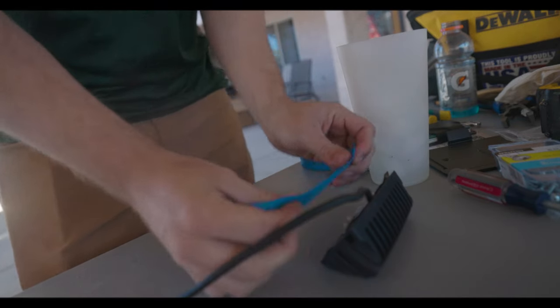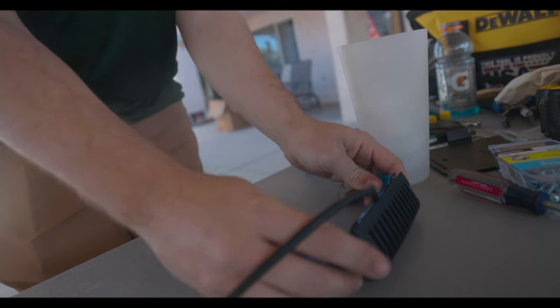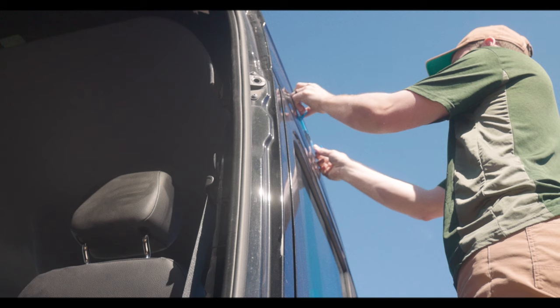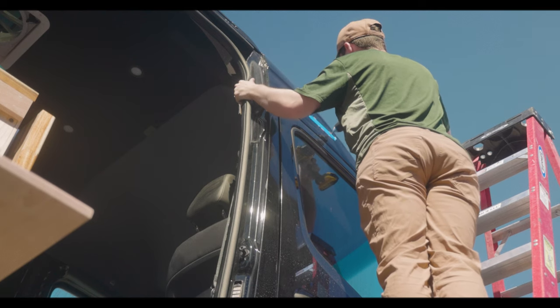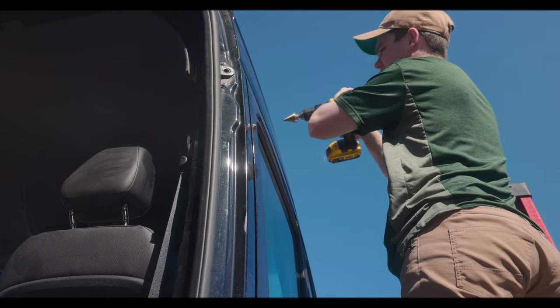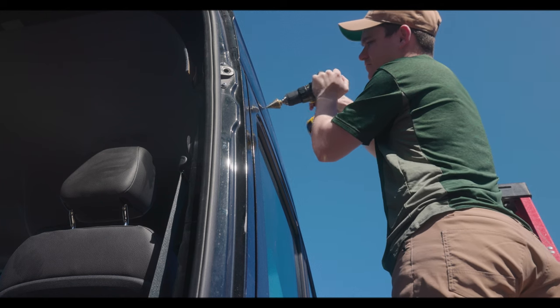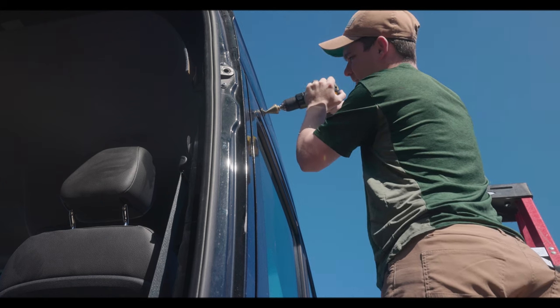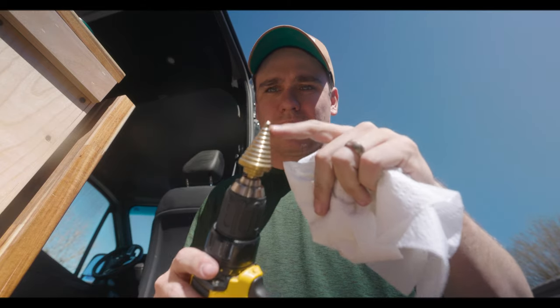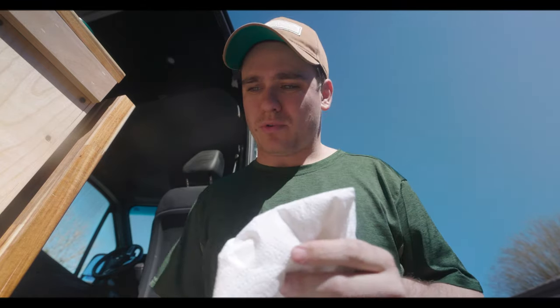We used a strip of painter's tape on the back of the light and marked where the mounting holes are on that tape, so I could use it as a template on the side of the van. With the tape in a place I liked, I drilled pilot holes using a really small drill bit, then came back with a step bit and widened those holes to the appropriate size. There are three holes — two for mounting and one for the electrical wires to go through. I used the step bit to make sure I didn't go past what I needed, then cleaned up all the metal shavings and sprayed the holes with Rust-Oleum.